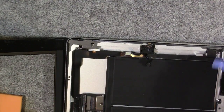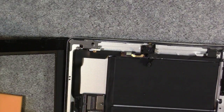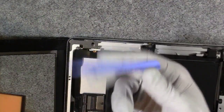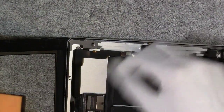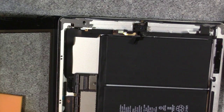So if you are having that NAND flash error pop up, go ahead and just disconnect this right here — this is all you want to disconnect and it turns back on. I do recommend if you are going to do this to be very cautious. Buying tools like this does help. I used old screen protector-like cards along with this tool to take it off — it's very thin and flexible. Be very careful not to break your digitizer. I hope you found this helpful and I hope this solved your error. If you have any questions, leave them in the comments. This is not an easy task, so please make sure you are up for it. You might want to set aside one to two hours to make sure you do it with precision and patience. Thanks for watching and I'll see you in the next video.